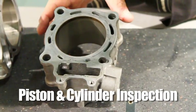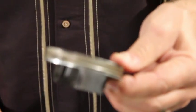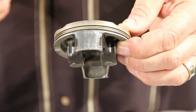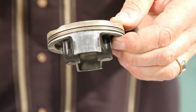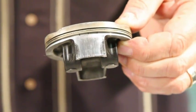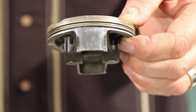We've already removed the old piston and cylinder from the engine. Give it a visual inspection and take a look at how the piston looks as far as wear. You can see this one — the skirts are polished quite a bit. That doesn't mean it's worn out; we'll measure it and make sure. Most of these four strokes, if ridden really hard, you probably don't want to run a piston much more than 20 hours. Those who ride easier can run them quite a bit longer. A pro level rider would change it out every weekend — that's about every two hours of racing.